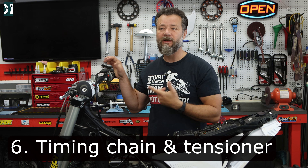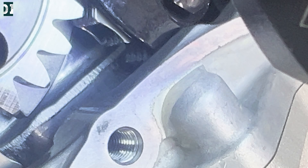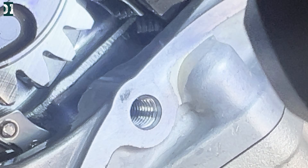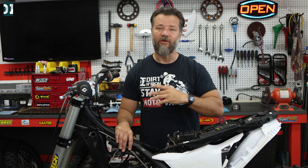These little things just touch the plate a little bit as it spins and it will find its happy place after a few oil changes and will not make any more grooves. Looking at how much they stick out compared to the depth of my groove — it's not even comparable, so I know this thing is sitting where it's supposed to sit. It did create a little bit of shavings but it's not a big deal. So we checked five things and still don't know the problem. Next I thought the timing chain might be slapping around, rubbing somewhere, creating shavings at startup. I looked at everything there and put in a new chain tensioner just to be sure, but after further research I found that what I thought was raw aluminum rubbing was normal, so the chain wasn't my problem.